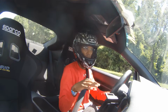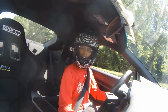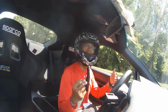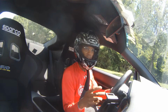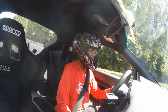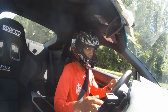Now, I was sliding all over the place as the car was getting warmed up, and that's one of the things with the Rivals. It has never been known for that first run to be awesome. It takes a little bit of temp, but the trade-off is when it's hot as hell outside, you don't have to spray them as much as the REs. That first run, you can go out and have a flyer. Second run is good too. Shoot, arguably the third run is. But the Rivals, as temps go up, they're in a little more favor. That's when they really shine, in my opinion.